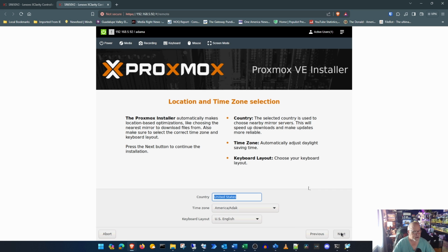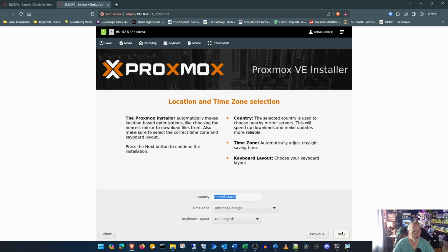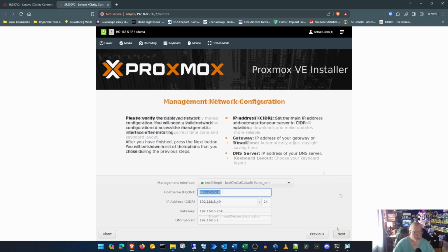And I'm going to choose next, United States. I'm going to choose Chicago. And that way it gets the right time zone. Click on next. And the name I'm going to call this is SR650v2.ujp.local because it is part of the Uncle Joe's Playhouse domain. So we're going to give this an IP address of 5.26 because that is one I have reserved for it.